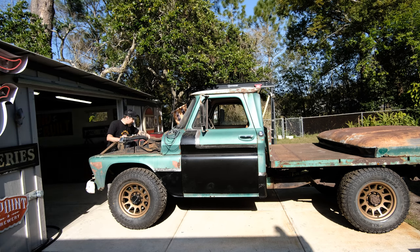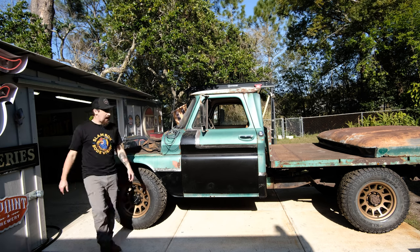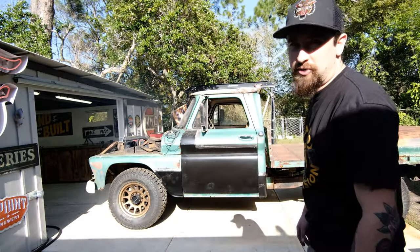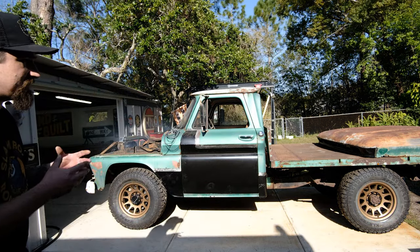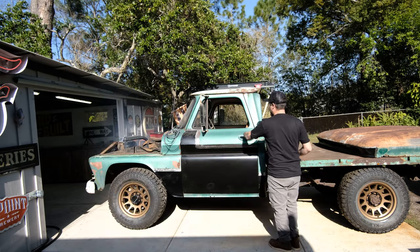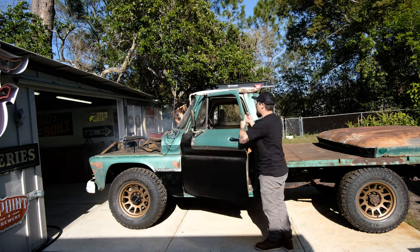We got some smoke burning off the headers. All good. She's just gonna let that burn off. Now it looks a little bit crazy. I don't know how well you can see it. It looks like a lot of smoke is just pouring from the engine bay, but one reason why I'm not worried about it whatsoever is because I can sit there and look at the headers and see that it's fine. Let me make sure I got good oil pressure. I don't see why I wouldn't. Oil pressure, 50 psi.